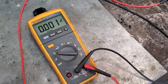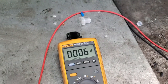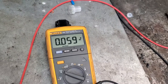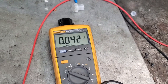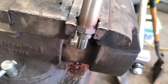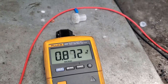I'm going to show you this here — using propane, warming up right now. I'm just giving a little bit of flame and taking it back off. Giving it fuel now, taking away, giving it a little bit — 700 millivolts, there you go. I'm just giving a little bit and taking it away. It actually does get cherry red in just a very small portion of that sensor to produce that amount of voltage. I'm only giving it flame for about a half second to a second.